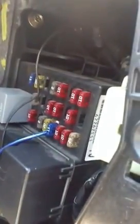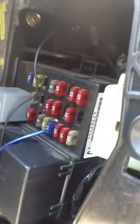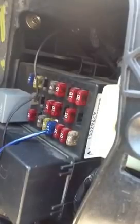It goes pretty good. And then, as you saw earlier, my remote turn-on wire comes from over there. Well, I get the luxury of having my fuse boxes in my car right here. So I've got it wired into this. You can see it right there. There it is, the blue wire. Got it tucked away and it comes up. It's wired into my turn signal fuse. That way, it only has power when the ignition is on. That way my amp's not draining my battery power.